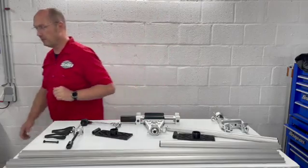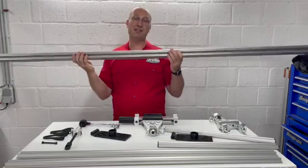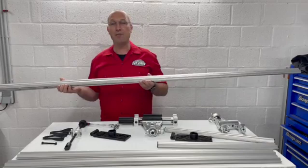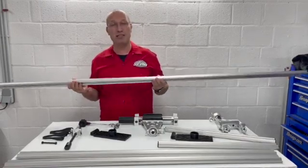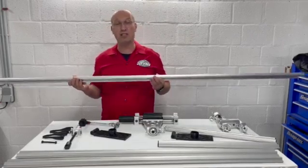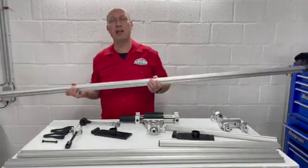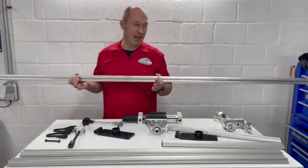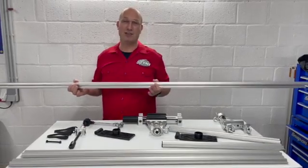I can barely get them on video, but this is a double size — 240 centimeters, or about two and a half meters. So if you want to repair a big bedside on a big Mercedes van or a Dodge van and stretch the panel with lateral tension, you can connect these extrusions and use the lateral tension tool. You can see how adaptive this tool set is — it really is a big dent repair tool.